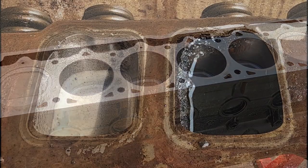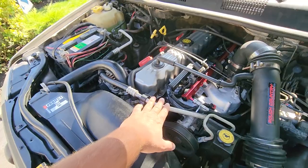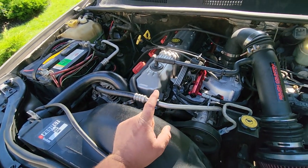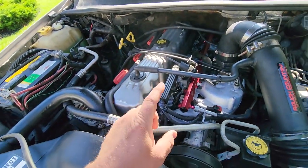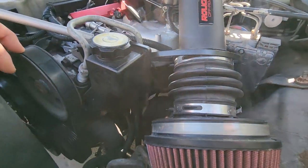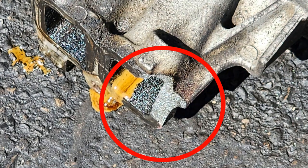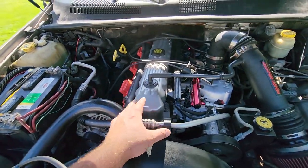Once the engine was out, I polished up the pistons, cleaned up the ports of the head, put on a new head gasket, and a Rugged Ridge aftermarket tubular exhaust header — it fits, though I had to make the number four bolt a little shorter, and I had some issues mating up the Y pipe with the down tubes since this thing has cats, making everything harder to access. I also put on a new intake manifold — the other one was busted — and found another busted piston. I did a whole refresh on the top end and painted it up.